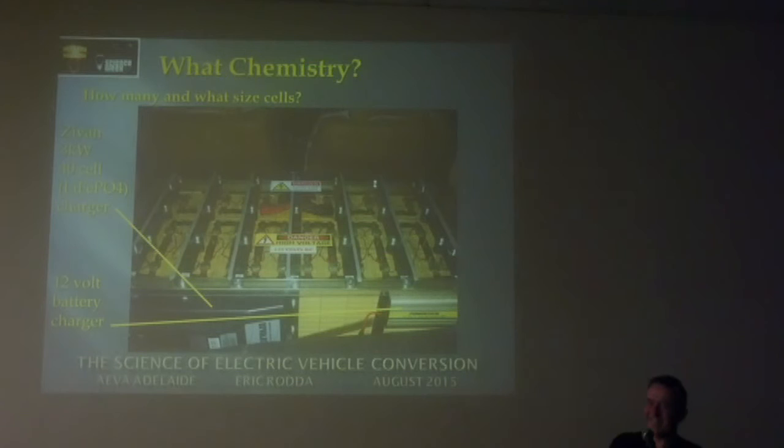You've got no brushes. I did have a problem with the brushes in my electric motor, and they wore out prematurely. That's odd. Yeah, I think I've done nearly the same amount of kilometres since I changed them as I had done before, and there's no wear at all shown. I took the clutch out of mine because the torque of the motor was destroying the new clutch plate, so I did away with it and put a solid connector in. While it was out, I thought, from your experience, I'll have a look. My brushes are barely worn, and I've done 35,000-36,000 kilometres.